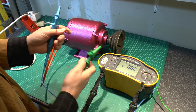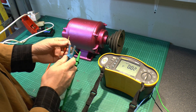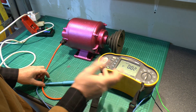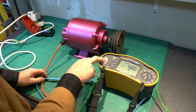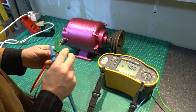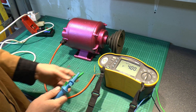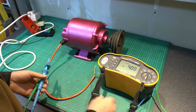The next thing is to just check continuity between line and neutral, to make sure they are in fact connected. If this shows as open circuit, it means the motor is either completely bust and burned away, or there's some kind of broken connection. What we should see is a fairly low resistance, but certainly not zero. There we go — about 4 ohms. That's fine. If we had a short circuit it would mean one of those is shorted to the case, causing a big bang on switch-on; if open circuit, it's not going to work at all — busted connection or a burnt-out winding.